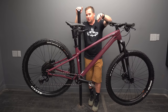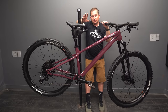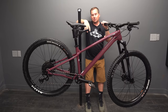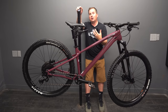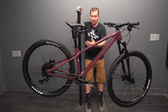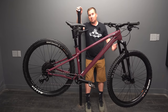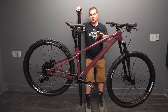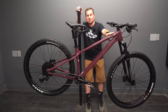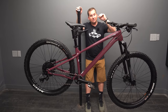We'll see on the ride feel. But that's kind of the goal for me, is to find an entry-level hardtail for my patrons and for you guys who are looking for a great hardtail without breaking the bank. Finding a great one that's worth upgrading and putting a great fork on and a longer dropper and maybe a great wheelset and having a fantastic bike that you upgrade piece by piece as you can afford it. And so I'm approaching this as if this frame were the best of the best and it was worth putting really cool stuff on. I feel like it is.